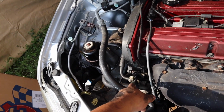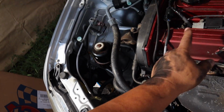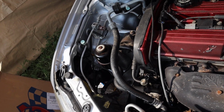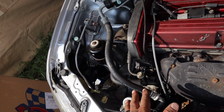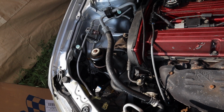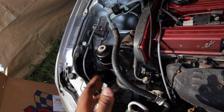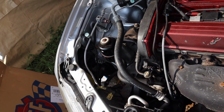I still need to figure out why the power steering pump return line that comes to the rack is still leaking. I tried every washer seal whatsoever and I could not get this thing to stop leaking. I looked up parts on STM too. They don't even have a washer that goes on top there because they're discontinued. So I would need to find some time to look at my Evo and see what kind of washer it uses to stop leaking.